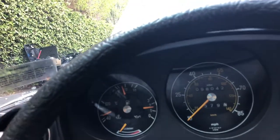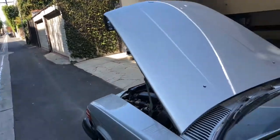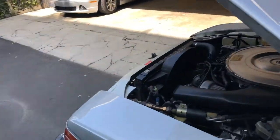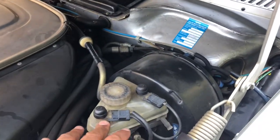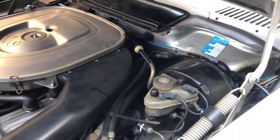Temperature is maintaining under half. I'm going to let the engine run for about 10 to 15 minutes while I'm checking other stuff — I really want to see if the car overheats. No abnormal noises from the bottom or the top end of the engine. The brake fluid is getting a little dark, still useful, but at some point you'll want to exchange that fluid — it should be a nice tan color.